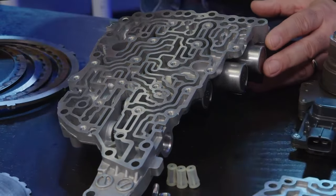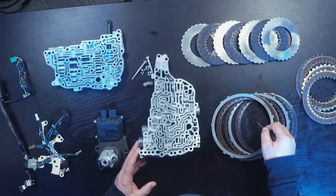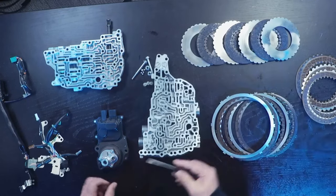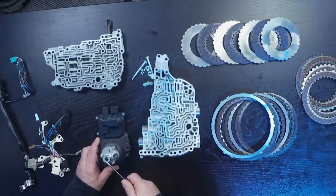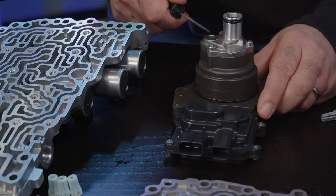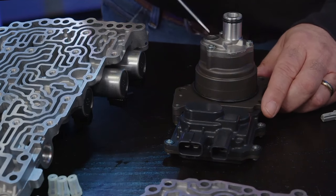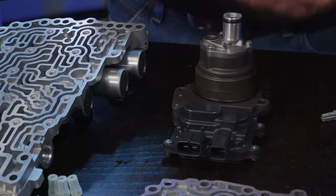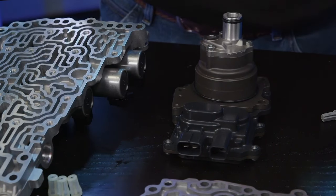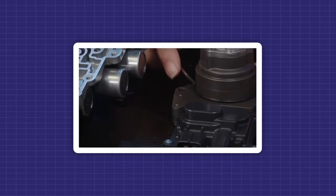These clutches can be slipped, so there's a temperature sensor that monitors the heat of both the forward and reverse clutch — it's called the C2 temperature sensor. If it starts to overheat, that's what this electrical motor is for. It is plumbed to a tube going into the sump, and the output runs through plumbing from the side of the transmission all the way around the backside, where it enters the circuit to supply cooling pressure on the hub where the forward clutch sits. The cooling oil comes up around the outside of the drum and can also reach the reverse clutch, cooling both the forward and reverse clutch.